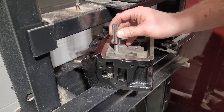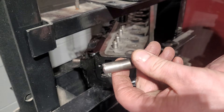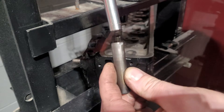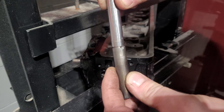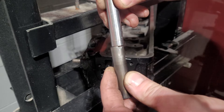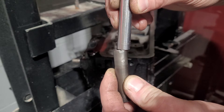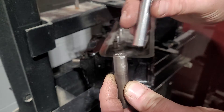With one of the valve guides, I wasn't exactly flush. So what happens is I ended up with a broken, twisted guide — it's all pushed in. The reason is that when it was butted up, it wasn't exactly straight, so it was off a bit. When it went off, it turned, I put pressure in, it ended up broken and actually went down. Because of that, I wasn't able to reset it.